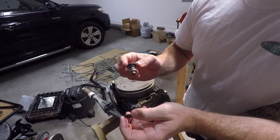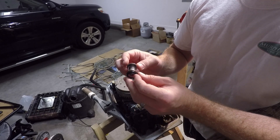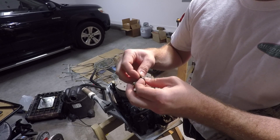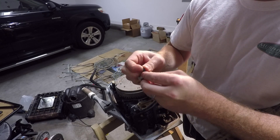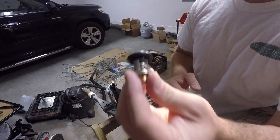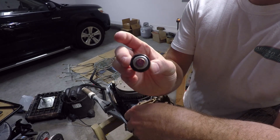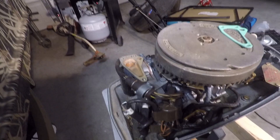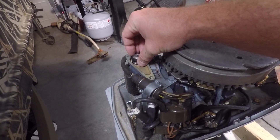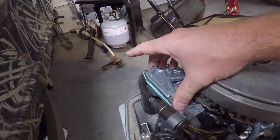The easiest way to install the top grommet is to slide it from the bottom. Once you have it on the bottom you can bring the edge up over, and after a little patience you can slide it on all the way around. Once you have the top rubber grommet installed on your thermostat you can simply slide it back into place and slip the top cover gasket back on.